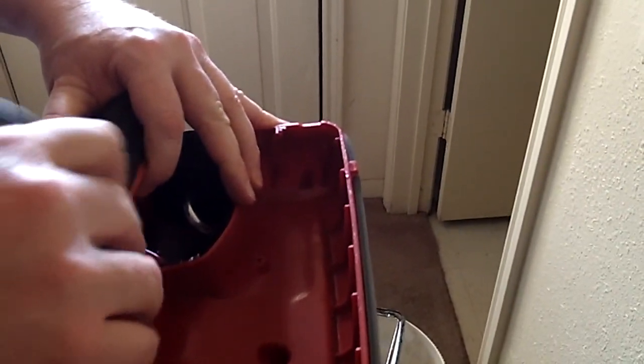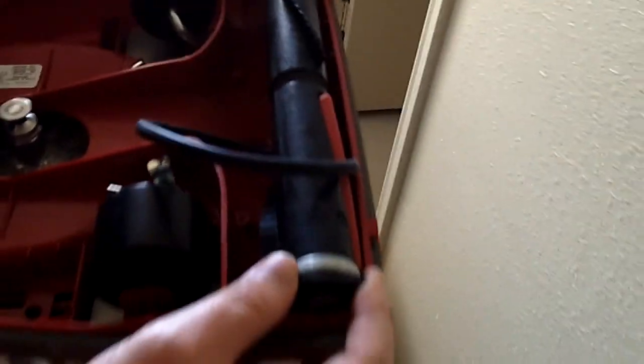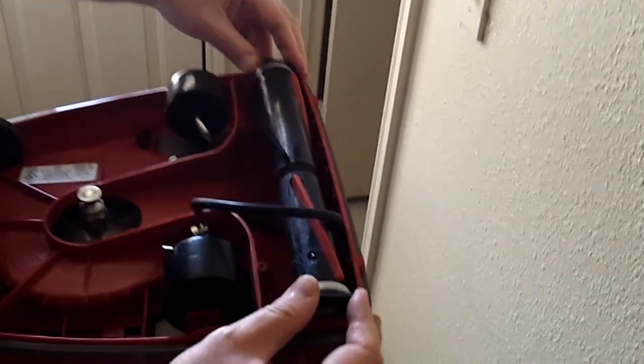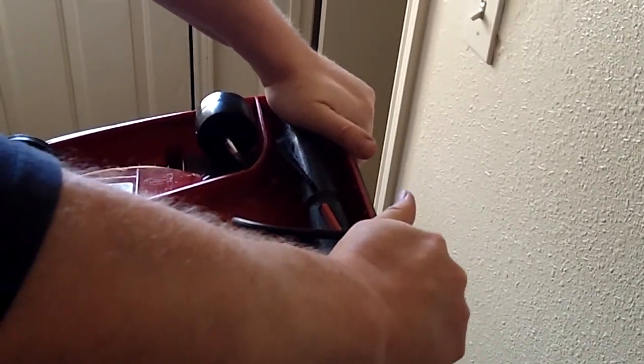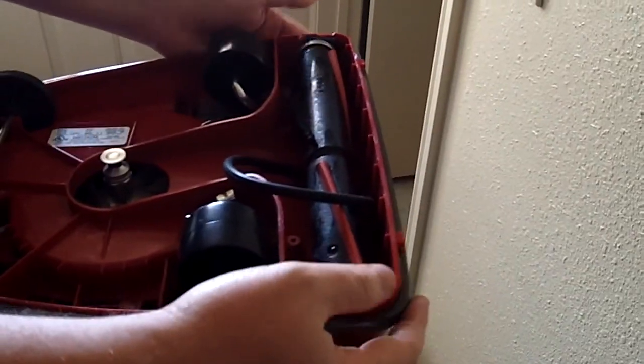And you can see these grooves, they're not straight up and down, you have to go in at that angle. So you want to make sure, because it's kind of difficult to maneuver, and when these things are new, they're real tight. So first you check that the point is down on one side, and I'll check the other point is down on the other side, and then you kind of got to find a way to get them started about the same time. Because if you get one side in all the way and not the other side, it'll be a little bit difficult. And it's kind of hard to push, but you just keep pushing, apply pressure, and push, push, push. And when they've been used a few times, they start to loosen up and they're not quite so stiff. Make sure they look pretty even on the sides. Kind of turn it a little bit by hand. Make sure it spins okay.